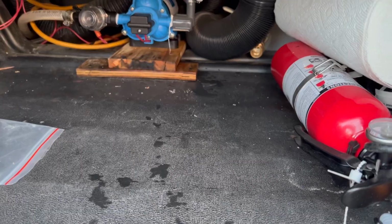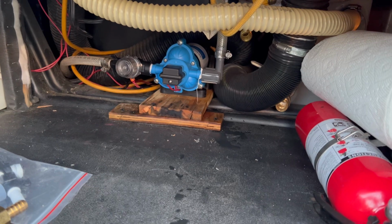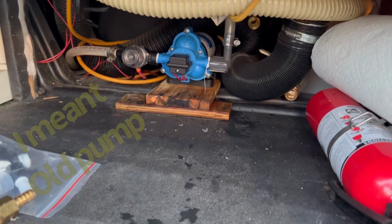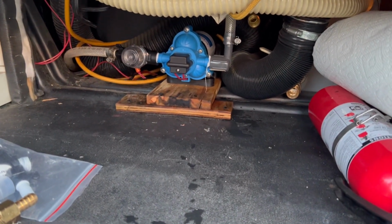Alrighty, I think we got it that time. Yeah, it obviously seems to need that angle piece on there to make it do what it should, so I put that back on, hose clamp back on, and you just heard the test again, and that seems to have done it, baby. Okay, so now the new pump's in place. So now I just need to put all the tools away and everything, and we'll throw that pump away and get on our way, baby. Yeah, well, and hopefully I can find some water somewhere along the way to refill my fresh tank.